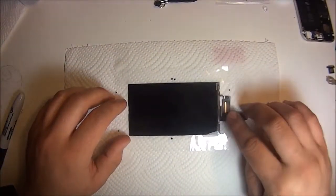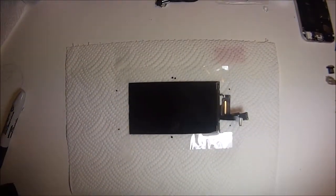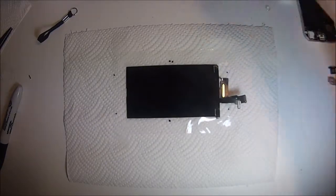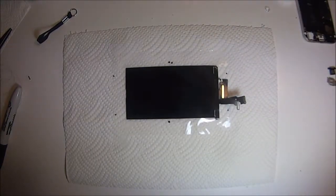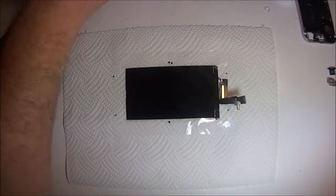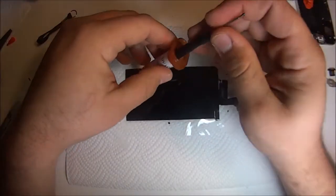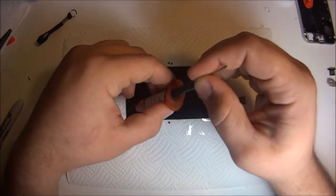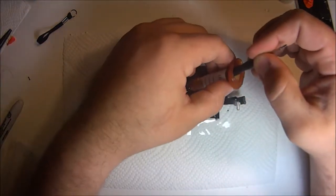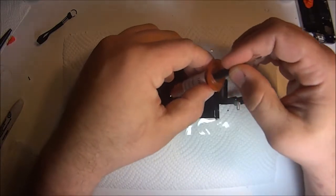And then once you've got everything nice and perfect, we're going to put the liquid optical clear adhesive, is what it's called, LOCA glue. Even if you scratch the hell out of your phone and there's a bunch of streaks from whatever product you use, if you didn't use the alcohol, this glue will kind of just make everything go away. It gives it that factory finish. You won't get any dust. It doesn't really cause any bubbles.